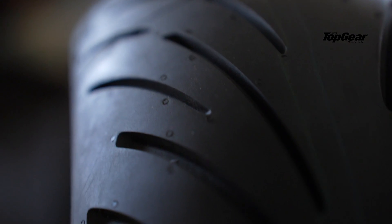The rear is a bit more interesting. The rear tire has been built with TVS Eurogrip's quadratic technology. Essentially, the surface of the tire uses a compound to enhance braking and acceleration — because when you're braking or accelerating you're mainly on the center — whereas the two shoulders on the outside have been given a softer compound for better grip when cornering.